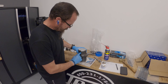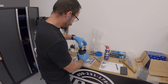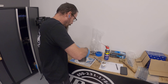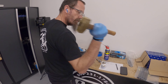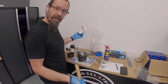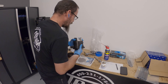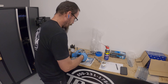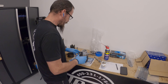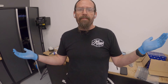This is a JC 92mm tapered ring compressor. It just starts out big and then tapers down small, and this makes installing pistons with rings installed way, way nice. You drop it in — this is, of course, lightly oiled already. Just like so. Take that and the wood side — and just like that, pistons installed. Let me push that all the way down to the bottom and push it clear of our wrist pins. Now I can put on my cylinder shims, get that all ready to seal in, and when I drop it into the engine, wrist pins are ready to go. I really like these.